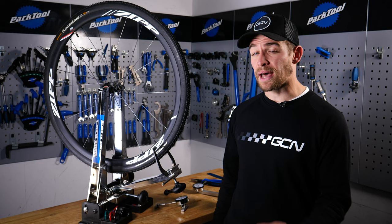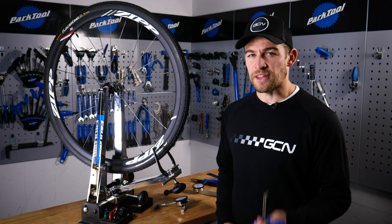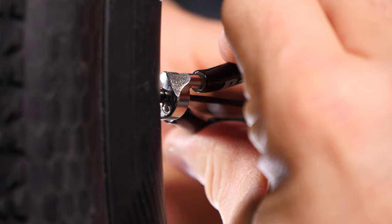There's one more thing I haven't mentioned, and this is perhaps more relevant if you're renovating a bike — making sure that your wheel stays within alignment. If you don't have a wheel alignment gauge like this one, you already own the best alignment gauge out there: that's your frame. Make sure that your wheel is dead true with your seat tube at the back, and that the center of your rim is in line with the center of your head tube on the front.